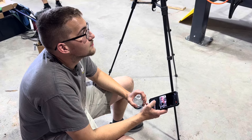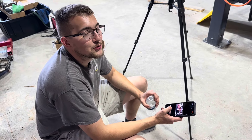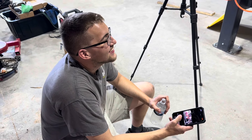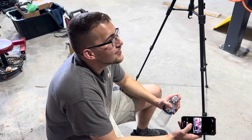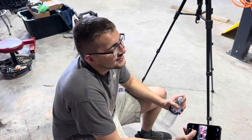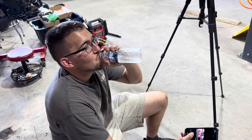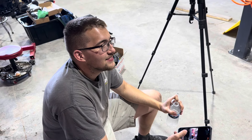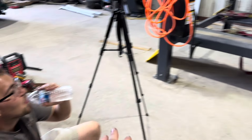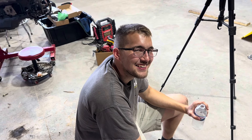It is a truck motor with truck cams and a Boss manifold — that's potentially not the best manifold for this application, but it looks cool until we put a supercharger on it. It's a matter of time with how bad of an influence I am. Or it might convince you to build a high compression Gen 3 combo — 12-to-1 compression, cam lockouts. Then we leave this one in and go from 360 to like 500 wheel NA and rev it to 8,500.